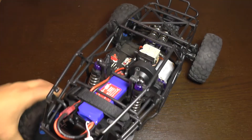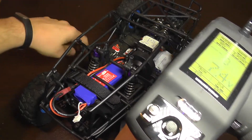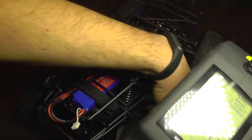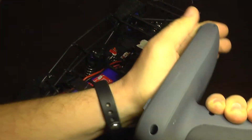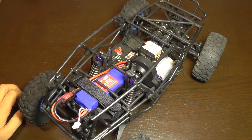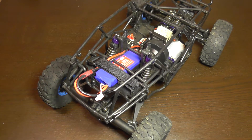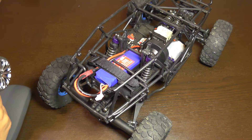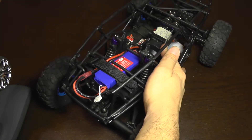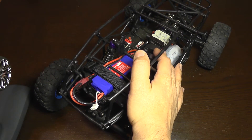Being 4x4, I will hold both the front and rear wheels and try again. You can hear it — that was the clutch spinning, so it's doing its job now. Just to be sure it's not too loose, I'm going to tighten it up just a bit, because you don't want the clutch slipping while running the car — it will overheat and burn the plates.